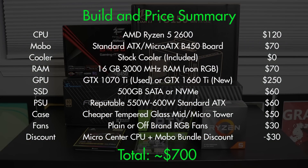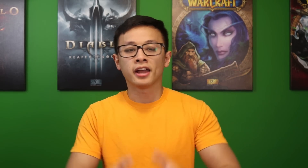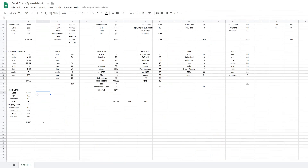Now there are going to be people out there that don't have this much money, but they also won't care about the ITX form factor, RGB, and don't mind buying parts from the secondhand market. So I'll give recommendations on how you could bring that price down. You can go one generation back on the CPU to the Ryzen 5 2600, which is still very viable and priced fantastically at $120 brand new. You can grab a used 1070 Ti or a new 1660 Ti, both capable of 1440p gaming, saving you around $100. And you can skip all the RGB and grab standard parts without the ITX premium. Doing all those things, you can save around $350. The key thing for any PC build is to lay out how much money you have to spend and allocate per component — make a spreadsheet, it's free on Google Sheets, and play with the numbers until it works for you. Always be cognizant of where your money is going and ask yourself: will I be happy with this PC for how much I'm spending? If the answer is yes, then that's all that matters.